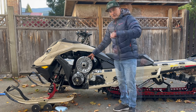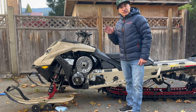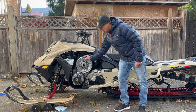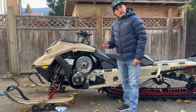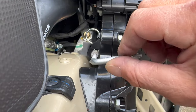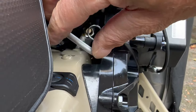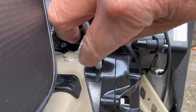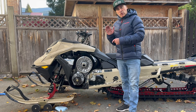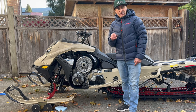Through the magic of video, I'm going to back it off five full turns and show you the difference. On the other side, I've used the chain tension bolt to back it off five full turns — now this is loose, you can see there's a lot of play in there. So I'm going to tighten it back up five turns. What you want to do is just hand tighten and then back off a full turn, and you'll get it to the ideal chain tension. On the other side, you'll see a bolt — you do not need to remove the circlip. You'll notice there's a D-shaped area on the clip that'll set in, and that's where you want to set it, so if it's a little bit more, just turn it back to that point and it'll ensure you have the proper tension every time.